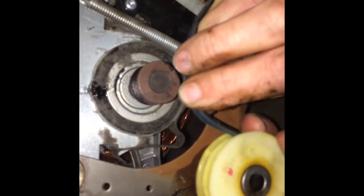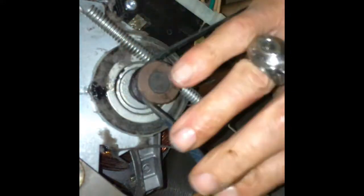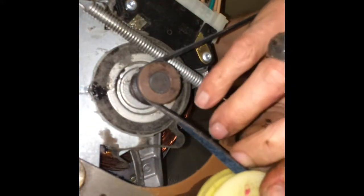and I'm going to switch the camera around so we can see how the pulley on the motor and the spring tension pulley line up. So we're pulling back on that white pulley and then putting the belt over the motor pulley, and then I'll turn the tumbler 3 or 4 times to make sure that the belt will stay on. You don't want to put it all back together yet unless you've done this part first to make sure that the belt is on there correctly and that it won't slip off. So maybe a couple of turns.